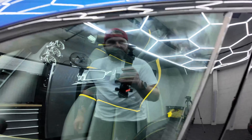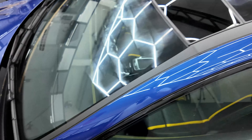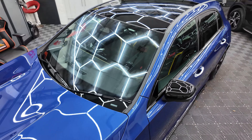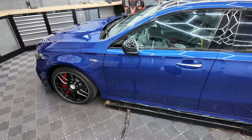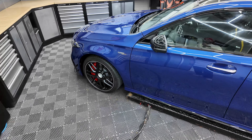So we've got the panel wipe here, and all this does is remove any polishing oils and anything that's on that panel. That's sufficiently wiped — grab the torch quickly, and there you go, that's a true reflection of how the paintwork is looking under direct light. Lovely, glossy, perfectly clear, and all prepped for the coating. That gives you an idea of why the single stage process takes so long — we're working on small sections all the way around the full car. Afterwards we'll move on to coatings. That's all the polishing work finished, and after polishing we stick on the glass sealant, which goes on all the glass surfaces and is left to cure for 10-15 minutes, then buffed off. After that we get the full car panel wipe — that's the end of day number two, and day number three we do the coatings.